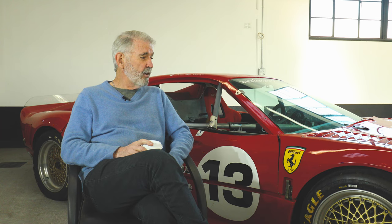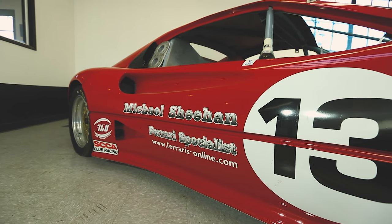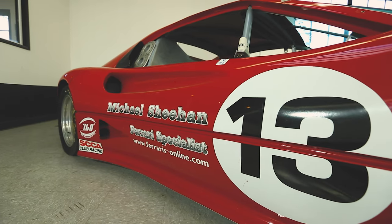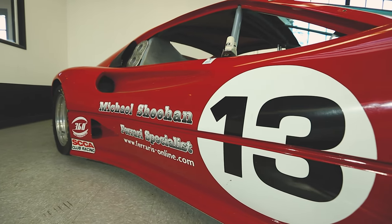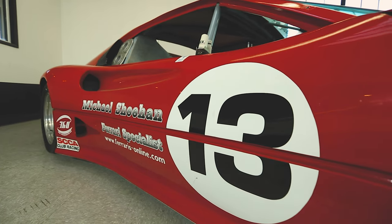I have over half a million dollars into this car, spread over several decades, to make what is a very sophisticated race car. It was originally built with a two-valve engine which put out 400 horsepower on the dyno, which is really impressive. The engine was mounted in line with the Hewland gearbox behind it, and it came in at 2,280 pounds, which is exactly what we wanted. We took it to Road Atlanta, tested it, and we were ready for the IMSA series.